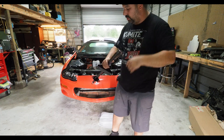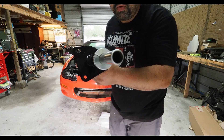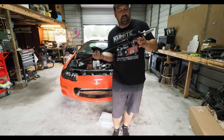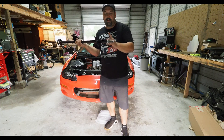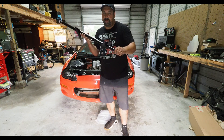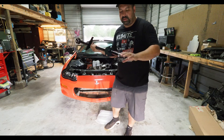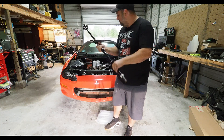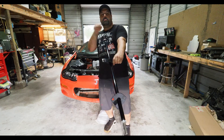The lightweight chromoly steering column from Motion Race Works comes pre-drilled with the Strange quick release — five bolt, though you can ask for a six bolt. Super cool, weighs nothing. You can adjust the collar, and you can watch Doug's video on the Fox body version. This one is obviously for the Camaro F-body, but you can shorten it if you really want — some guys shorten it for different racks like pinto racks with a U-joint adapter, but we won't need that. This will bolt right up to the firewall.